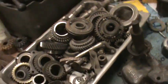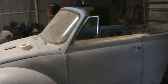I'm going to get out here and get this shop cleaned up. I've got the convertible back in here to touch up some rust spots. The epoxy primer failed a little bit here and there, basically on the tops where water was sitting. We didn't use the Matrix on this - we used PPG epoxy primer - and I'm going to hit it with Matrix this time.